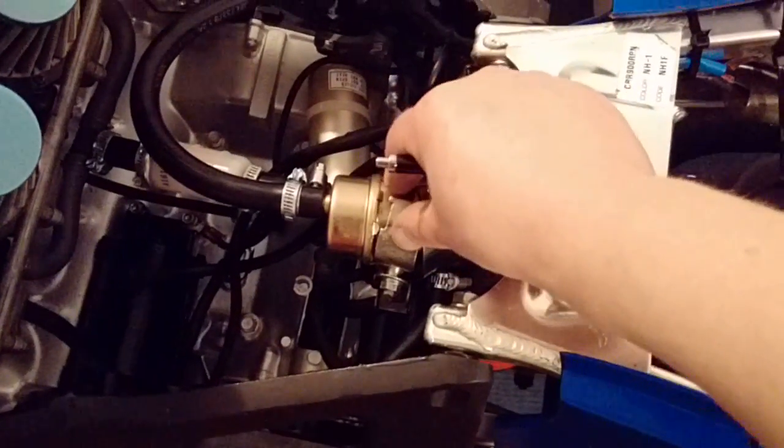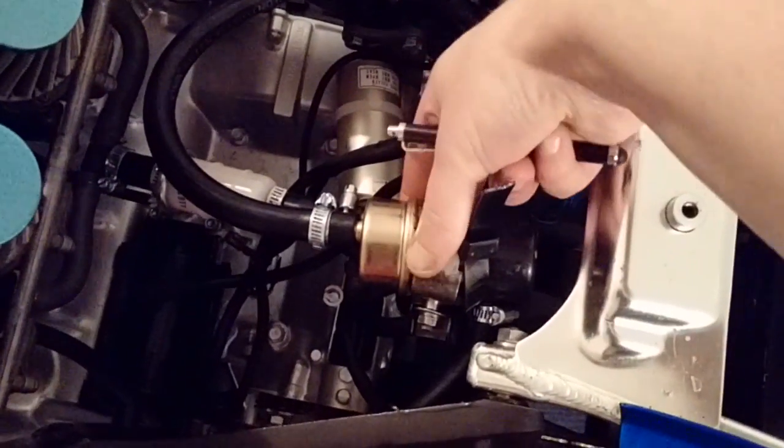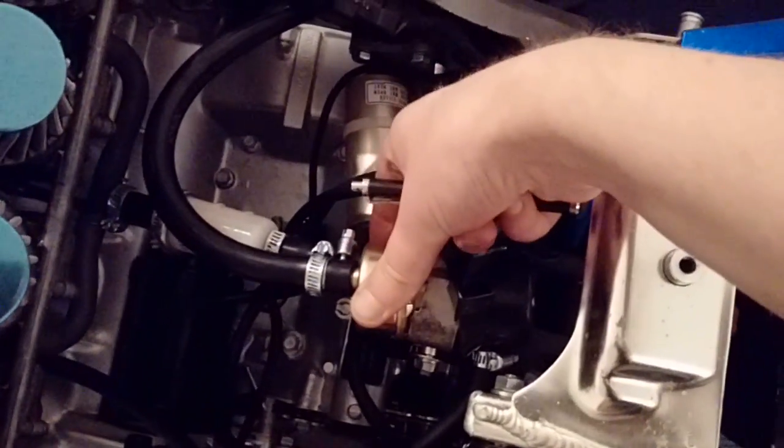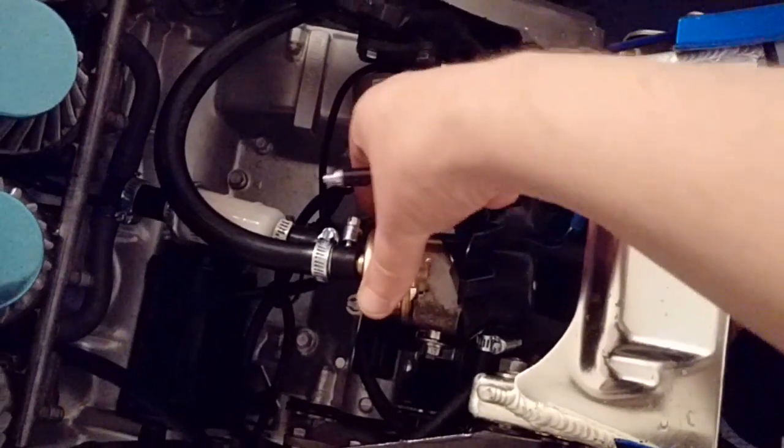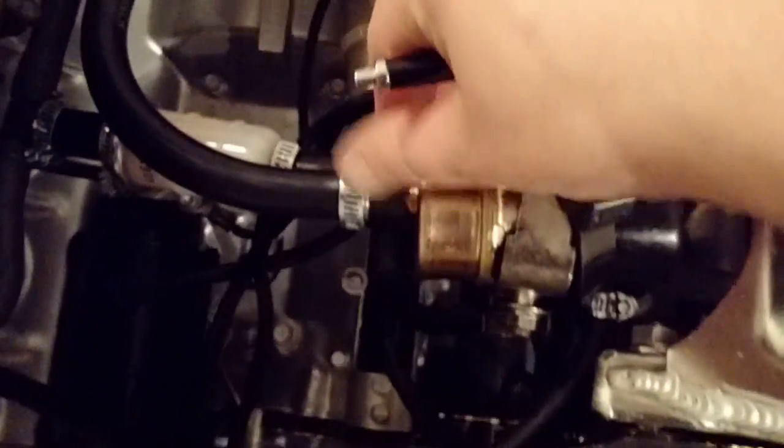Here is the fuel pump — I've attached it with the original bracket. I don't have the proper rubber mount so I've used heavy-duty cable ties to hold the pump in the bracket, which is C-shaped so it holds the pump quite well. The pump is wired into the loom, it's got the drain hose and what I think is an air bleed-off hose which goes down the side of the bike, tucked in front of the sprocket so any air in the fuel can escape that way.